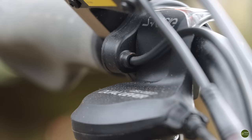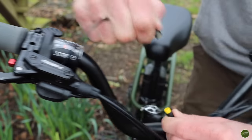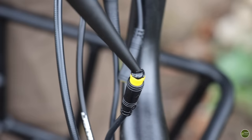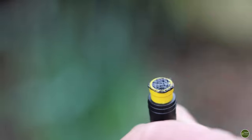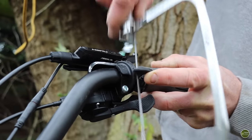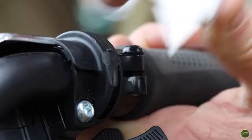Now there is a fairly simple modification you can do to remove the throttle, and that's what I've done to my bike since filming the last video. The throttle has a cable which sends a signal from the trigger to the control unit, and this cable has a plug on it. So it's a simple case of just pulling that plug out. I then smeared some silicone into the socket end of the plug, and then I cut the cable completely off where it goes into the throttle housing itself. I also cut off the actual throttle lever on the housing, and I've sealed that up with silicone.